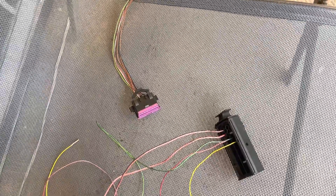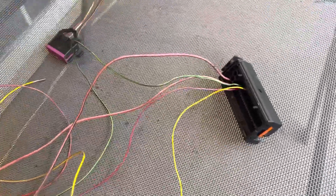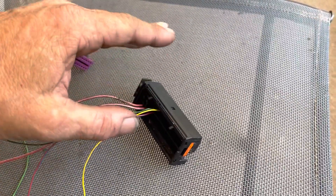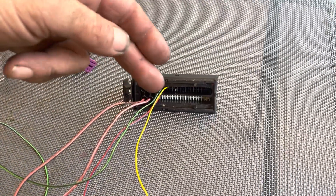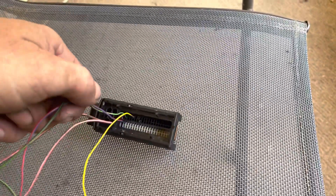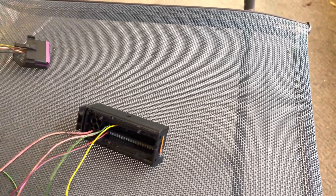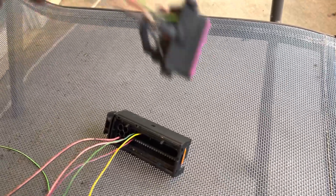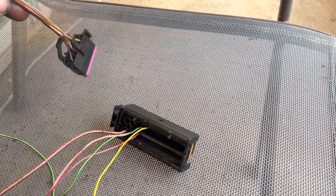I'm in the process of building my own jumper harness to put the ECU in boot mode and to bench flash the ECU because of the immobilizer. I cut the old diagnostic connector out of the A6, and this is the leftover ECU connector from when I did the wiring conversion. You only need a few wires — two grounds and a power wire going into that middle connection. Then you have your K-line, which has to hook up to the diagnostic port, because that's how you're going to communicate with the computer. These two other pins get power along with that third pin, and then you'll have power and ground going to this and the K-line. You'll still have to ground a pin inside the ECU and I'll show you how to do that.